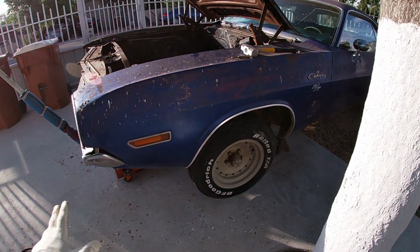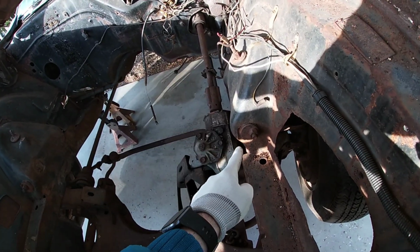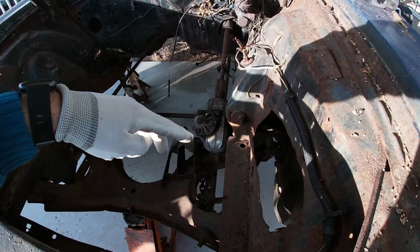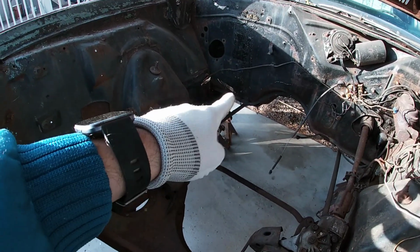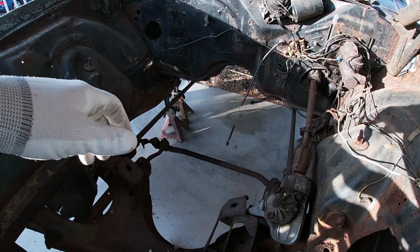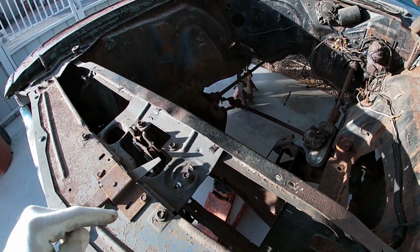I have the car on jack stands now, so I am ready. I'm gonna take off the front tires there, and I'm probably gonna start up here. So the shocks here on top, these are the control arm bolts, so they're on both sides. Then once I do that, I'll move on the bottom and start taking off, I think probably the K-member bolts here. I think there's 4. I know I have to remove those strut or torsion bars, and so I'm hoping that once I have this down, they'll kind of pull out of there, but we'll see what happens. Everything's kind of rusty and seized in place, so I might have to really motivate them to come out. But start with the tires, these bolts here on top, and then move on.